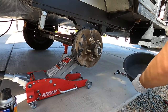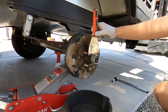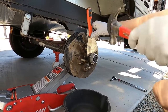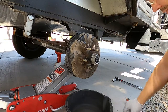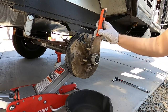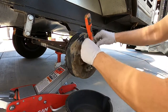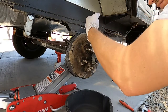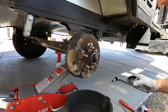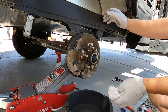And there's the trailer axle. It does have a rubber boot at the end, and you would just take that off if you wanted to change out or put in more axle grease. I'm putting a thin blade in between the metal to separate that cup from the rest of the axle. If you wiggle it back and forth you get enough separation where you can put a thin bladed flathead screwdriver in there and pop that cup off — and you can see that grease is pretty dark.